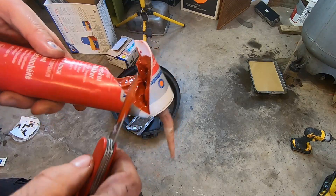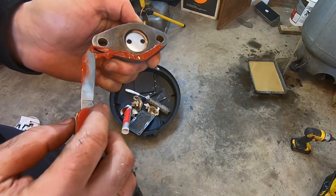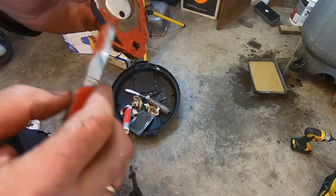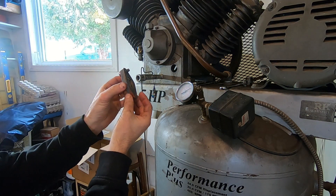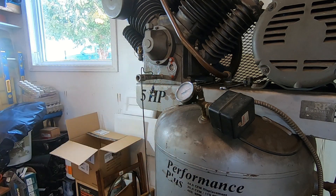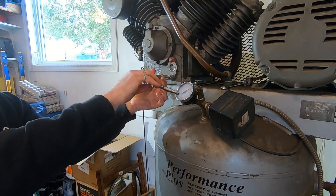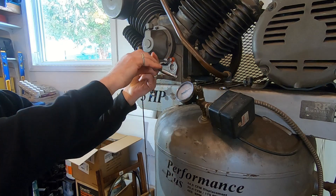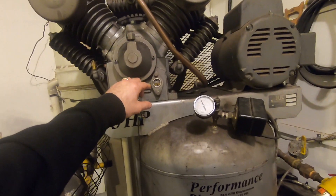This is so embarrassing — have you ever had to cut into the side of a tube because it's plugged up there? I always end up putting on 10 times what I'm supposed to. Notice I'm not really putting sealant on the thread of the bolts — that's really not necessary, it's more about the head. When you're sealing up a surface like this, you tighten the bolts up just so they're snug, let the sealant set up, and then turn in the last little bit and torque the bolts up. We've got a thin skim coat, and we got her topped up with oil.